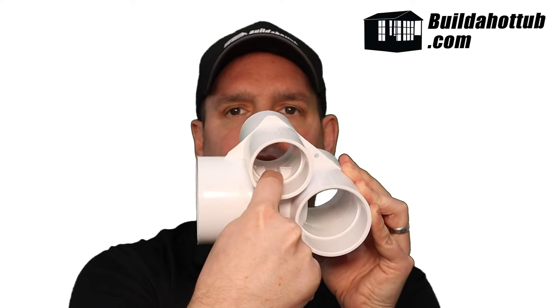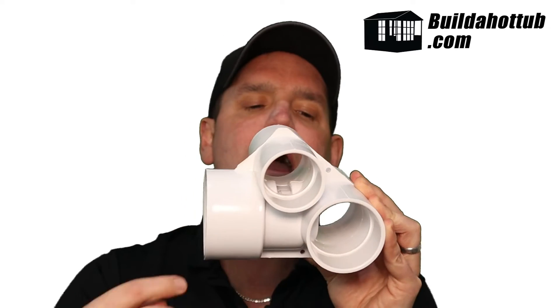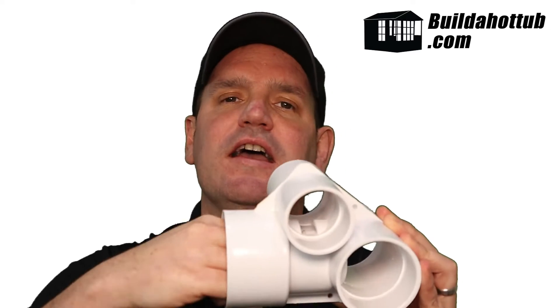As the water's going through, there's actually a hole on the air line and the water comes through under pressure out the front. Through the process of venturi, the air which is on the blower line is blown in under pressure and is then drawn into the water line, giving you a more bubbly, effervescent hot tub experience. I'm a big fan of air blowers but I know they're not for everybody. They can be kind of noisy and some people don't like that.